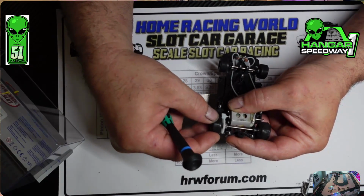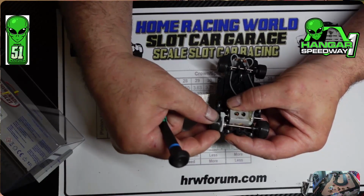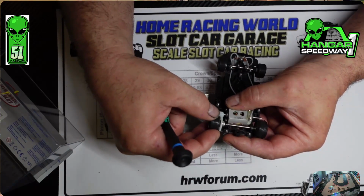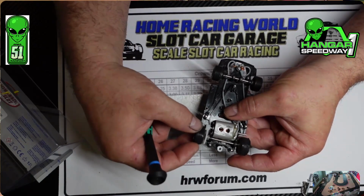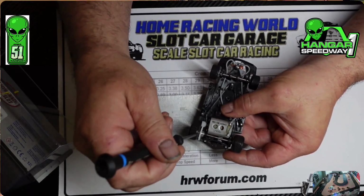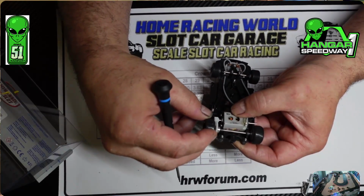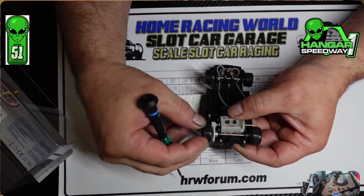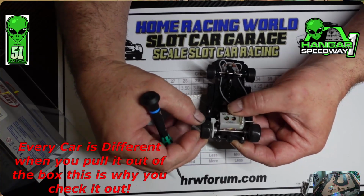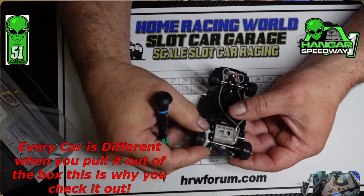You can make it a little bit looser than that, but we may need to space this out a little bit more, but it looks like that's okay. So that's where I'm going to run it at, and we'll test it. And then we can loosen it as well. If we do need to true this down or file that down, you can. It's no big deal. We're just checking to make sure nothing's contacting. It looks like that's going to clear even when I move it up and down. It's not touching the tire, the pinion gear, and that's what I'm concerned with right here.